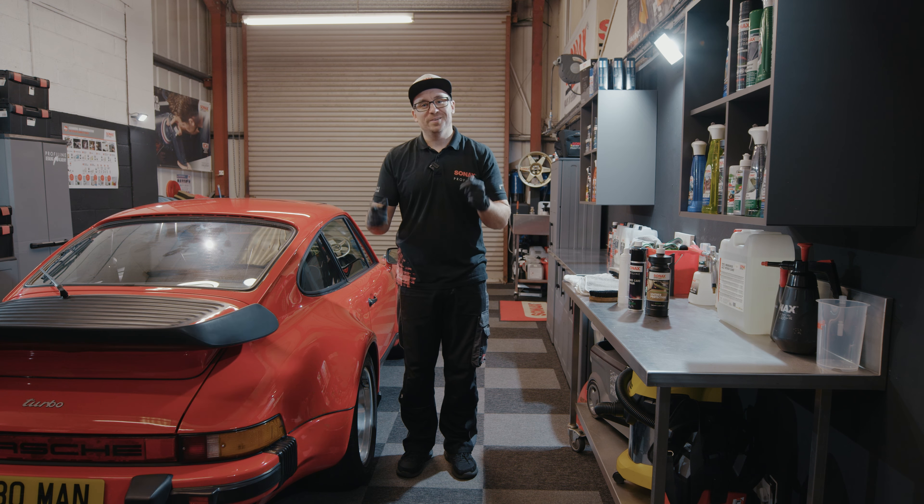Look at the state of that — what a transformation! So remember: don't over-soak the leather; use a brush to work into the grain but don't push too hard — the cleaner will do most of the work. Make sure you protect it afterwards, and just keep on top of keeping the leather clean, because the more you leave your leather to get dirty, it becomes prone to cracking and drying out, and the coating on top also gets damaged. It's an expensive, premium material, so keep it that way. Thanks for watching — please leave a comment, hit the like button, and subscribe because we have so much more cool content coming.